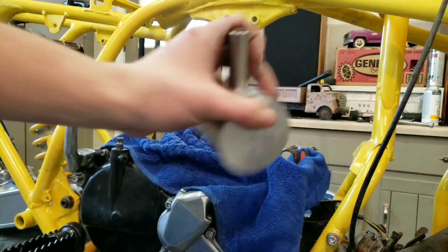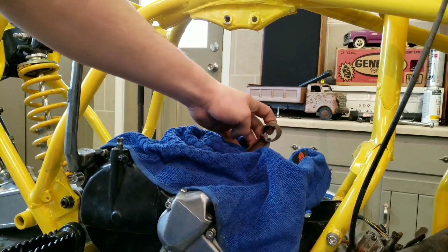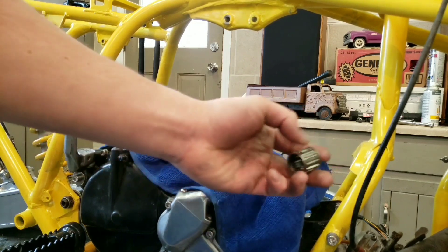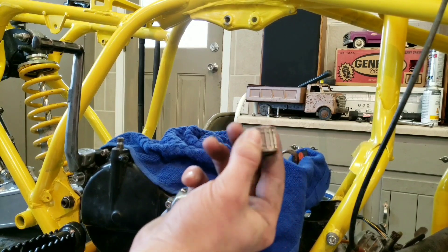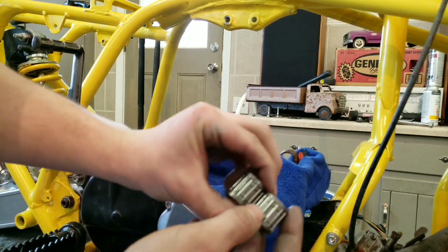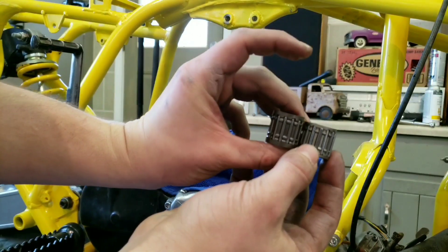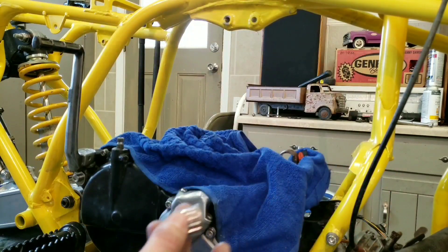I got the piston off — here's the connecting rod. I took the bearing out because if you look here, this is the old bearing and here's the new one. They look pretty much the same until you put them next to each other — you notice this one is a lot shorter, and that is to accommodate for the thrust washers.